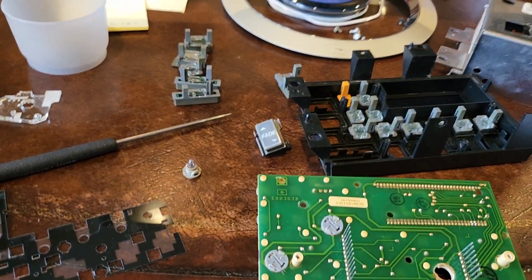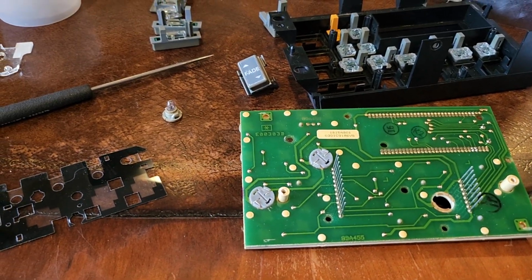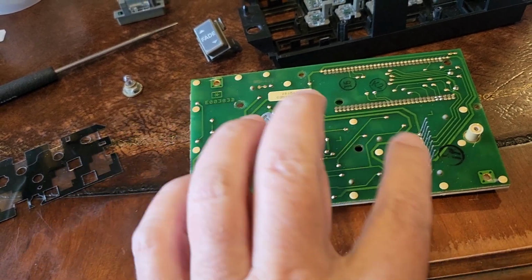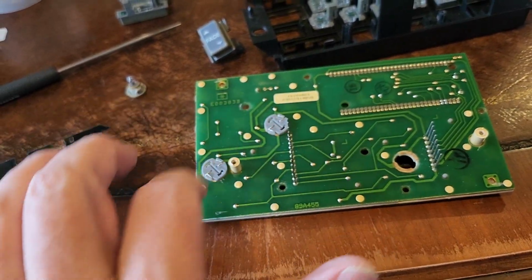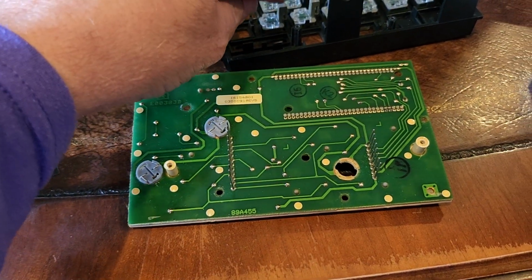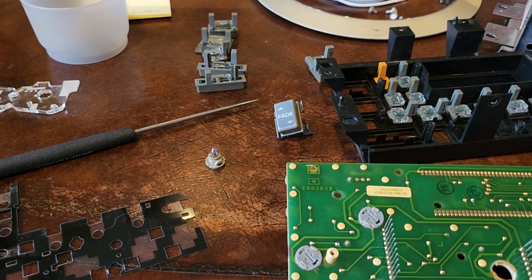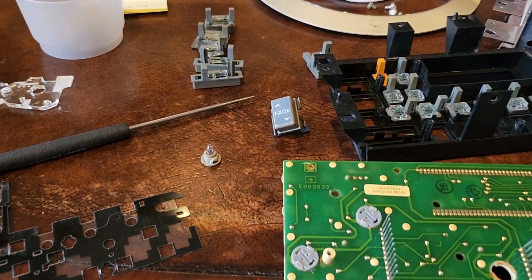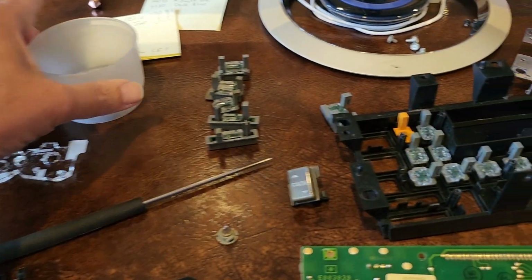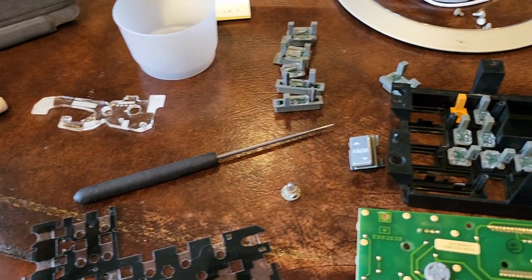So I would really like it if somebody was remanufacturing these buttons or had a more professional way of restoring them. But for now, this is going to work for me. So I've basically disassembled the radio face, went ahead and replaced the LEDs. Well, replaced the bulbs, although I may go back to incandescents. But if you want to replace the bulbs, you can. And then I'll take each button out, clean it as best I can, scrape any of the film, what I'll call clear coat, off, and then polish it up. And the hard part's going to be reassembling this crazy thing with all of these springs. Not looking forward to that, but hopefully it'll all be back together and looking better than it was.